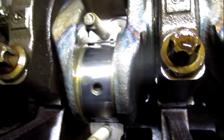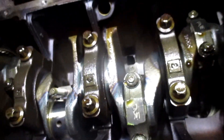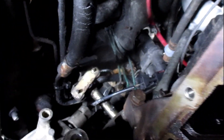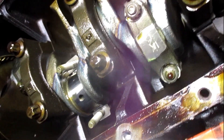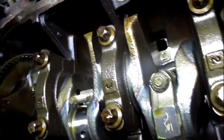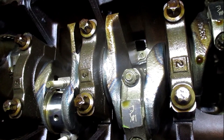Anyway, that's what's up right now. The shifter linkage is finally apart so I don't have to worry about that. I just have a couple of lines to take off, the power cable for the starter, and a couple other things, and then this thing should just pull right out. I've already got the header pipe and collector off, so we'll go ahead and pull the engine out and start pulling the head off.